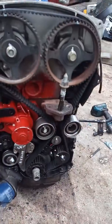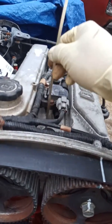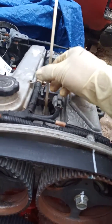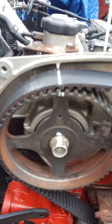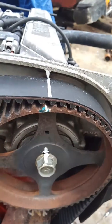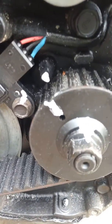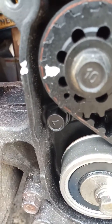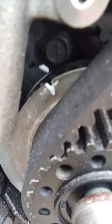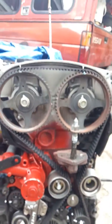clockwise, okay? You got it. Go turn this thing 390, all right? Make sure your top dead center piston is up, all right? Then you want to line this guy here with that notch. All right, there you go. Dot with that notch, okay? Second, you want to time the oil pump with that, okay? That one has to point out right there too, all right? There is an internal mark also right there, okay? Those are your points.